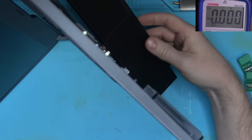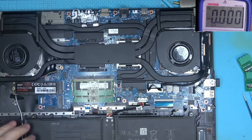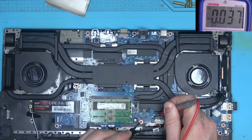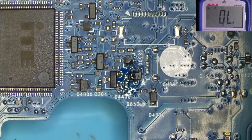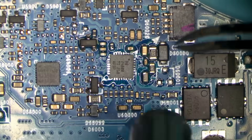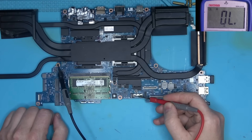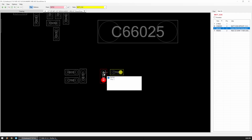The battery fell off because I forgot to screw it in, but it held — which means the way I attached the connector to the board is better than factory. Either way, the laptop is still refusing to power from the battery, so I went poking around some more. Fixing the issue with the present pin, I checked the board over and over but found nothing. I thought maybe the BQ chip was bad, so I had that swapped. But before I did, I checked the pins of the connector and found that the clock pin is shorted.